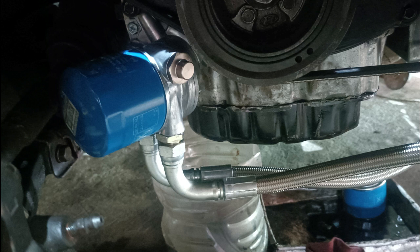Next, we found a thermostatic oil sandwich plate. The EVO 4 has an oil cooler stock — it's an air-to-air unit — however, since we are using Sonata components, there are no fittings for the oil cooler available in the standard Sonata oil pump configuration, so we needed to use a sandwich plate. Thermostatic means it's closed when the oil is cool but opens up when the oil is hot enough to require cooling. There is an operating temperature that oil needs to be at in order to lubricate the engine properly, so the thermostatic sandwich plate allows the engine oil to be at the perfect temperature — not too hot, not too cold.